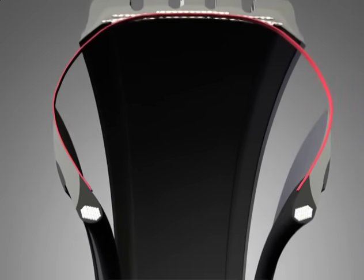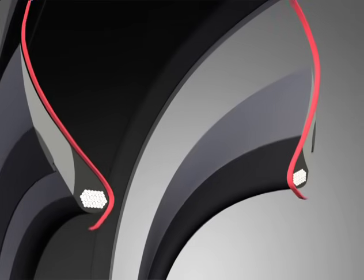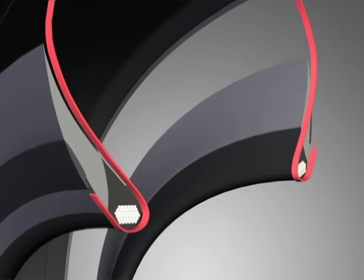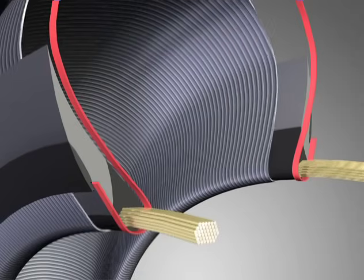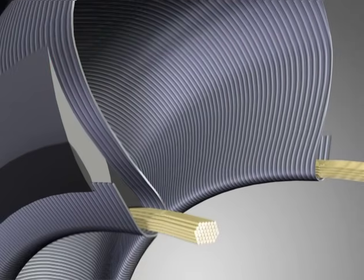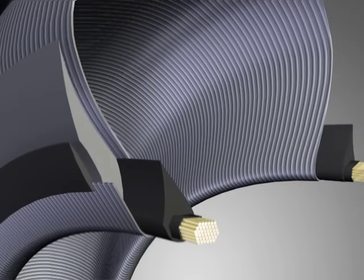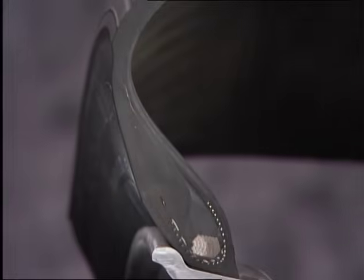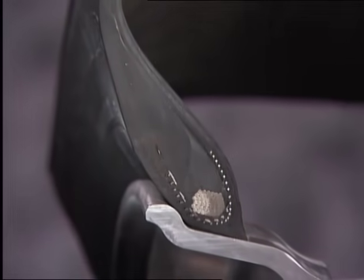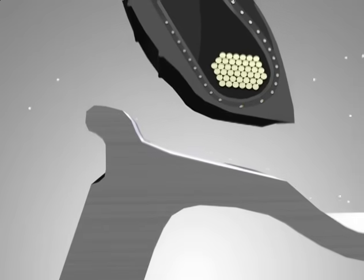As the body ply cords continue toward the bead of the tire, they suddenly turn completely around the bead and start back up the sidewall. This is called the ply turn-up because the cords actually turn up and head back the opposite direction. Inside the turn-up is a band of many strands of steel wire called the bead bundle. The body ply wraps around it. The space between body ply and bead contains several different kinds of rubber and fillers, each formulated to add strength while giving the area stress resistance. The bead is the edge of the tire — the place where the tire makes contact with the wheel — and it creates a tight seal between tire and wheel.